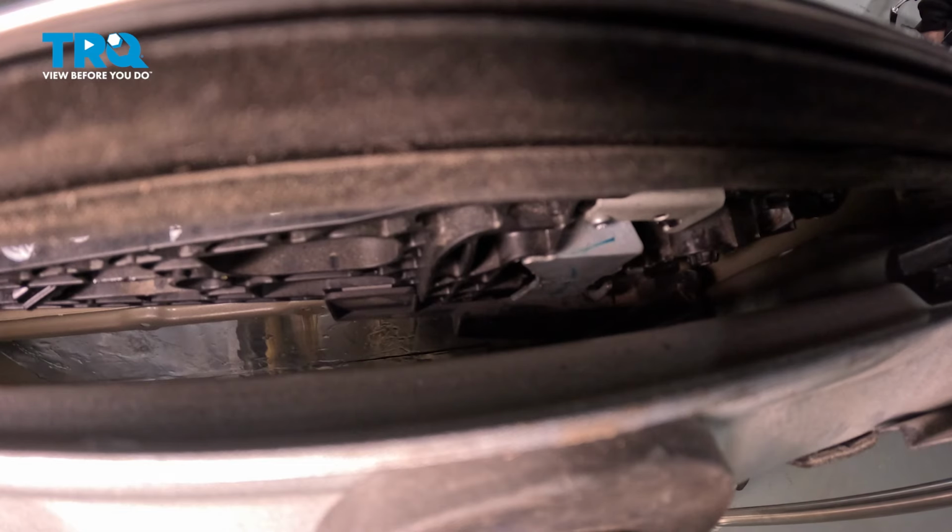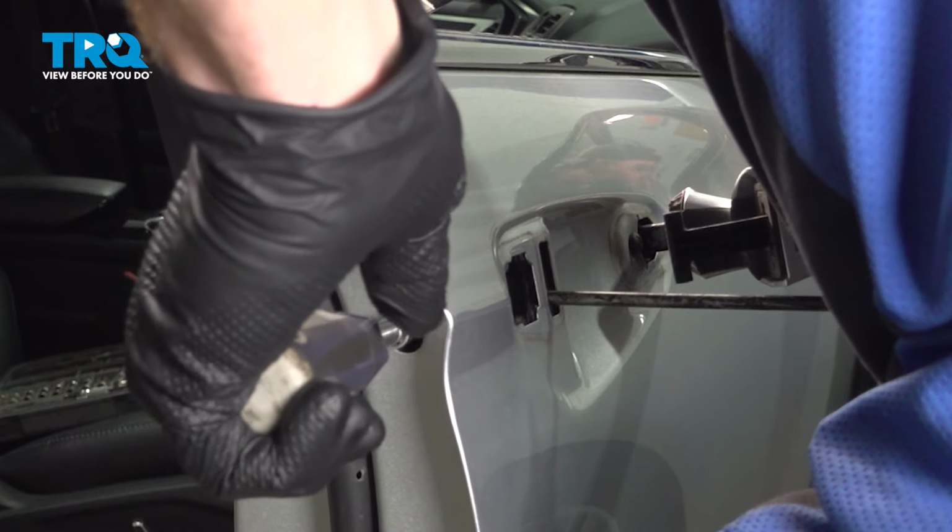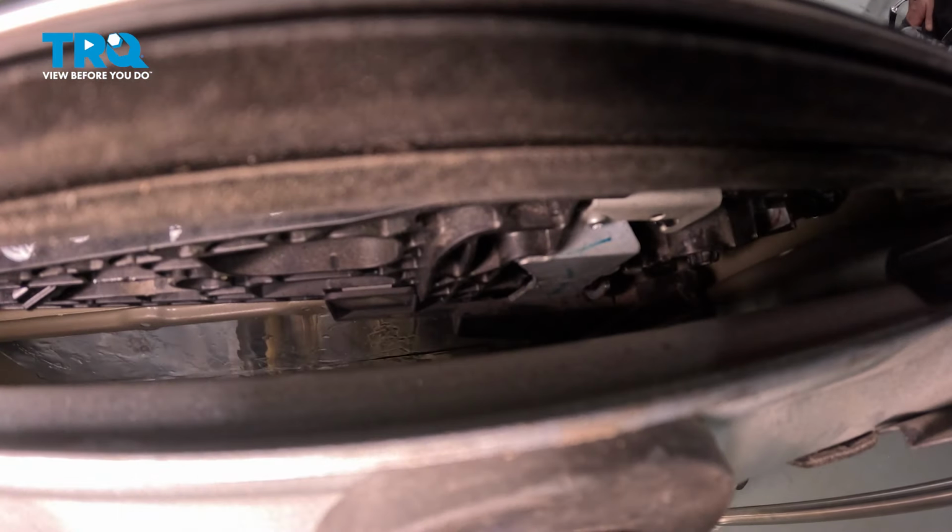Now you can see that gray area? You see how it just broke free a little bit further and came towards the inboard side? We need to hold it there now and push in our outer door handle. To do that, we're going to start turning the screw in the door jamb counterclockwise now while applying pressure. We're waiting for this to make its way to the point that it's holding in place for us. Should see things start to slide in here.